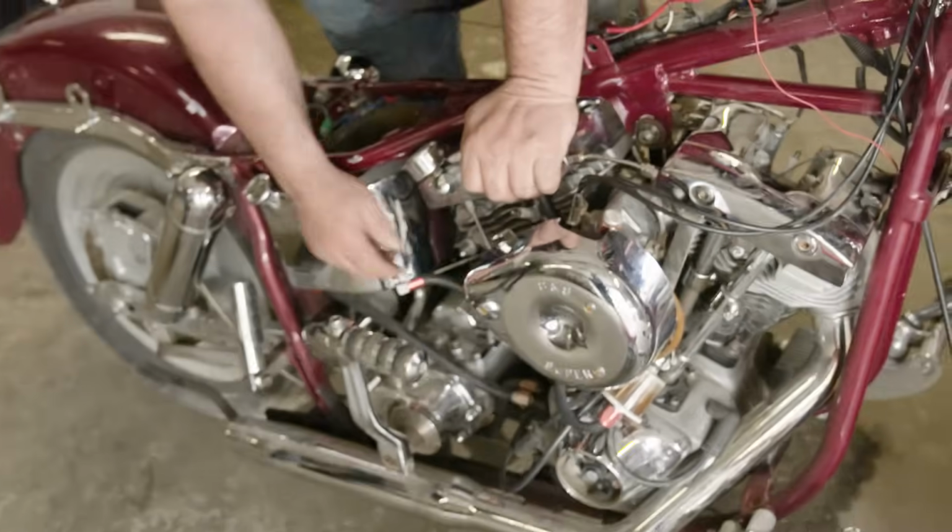We're working on the exhaust valve. So we got to make sure that we put that exhaust valve, it has to have a little bit more clearance than the intake valve because it runs hotter. And when everything gets hot, the metal will expand and grow. So that's why you put some clearance in it. So when it gets really hot, it comes up, it won't hang the valve open and burn the valve out.